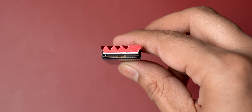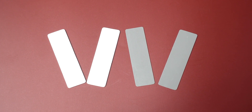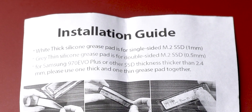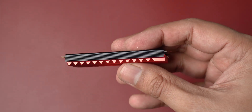The manual suggested which thermal pads to use for the infamous Samsung 970 Evo Plus, and I was pretty happy to see my drive's name specifically written on the sheet — it made me feel they'd done their research. Putting the drive sandwiched between the different parts of the heatsink was pretty easy. I first checked if both thick thermal pads or any other combination could work, without peeling their protective film. In the end, the manual was right: a thin and a thick thermal pad worked — thin on the middle tray, thick under the heatsink — then I just clipped it all together.